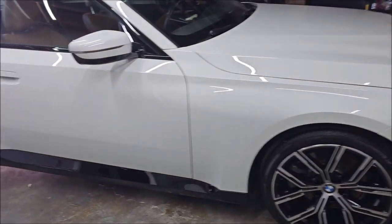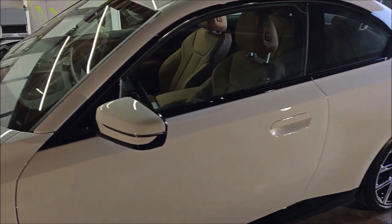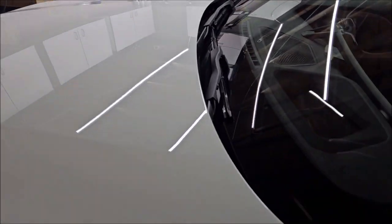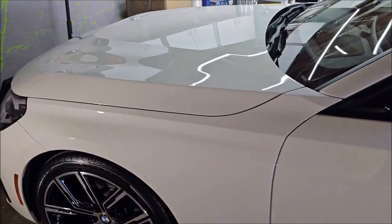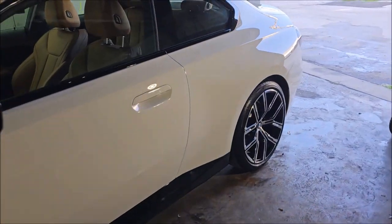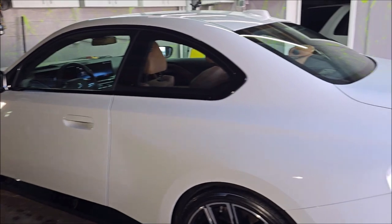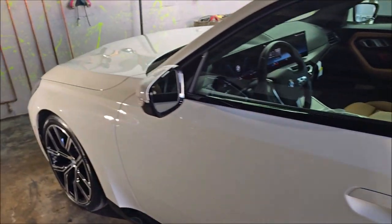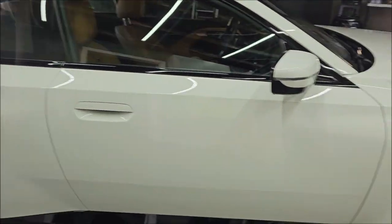Between Tony and I, we have about 12 man hours in this car. She looks great. Infinite Purpose Cleaner was used as the lube — really only needed to use it in the heavy spots in the back where it was really cured and biting down on the paint. I used my Japanese clay bar from DetailJuice.com, located in the miscellaneous section on the site. I used Forever Rinseless as the bucket rinseless solution, then Infinite Purpose Cleaner as the lube. I would dip the clay bar and towel back in the Forever Rinseless bucket to get all the IPC off the clay bar and towel.